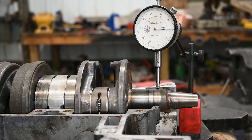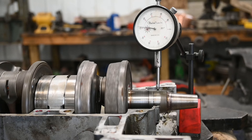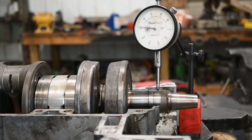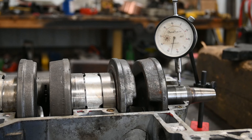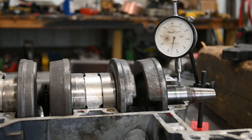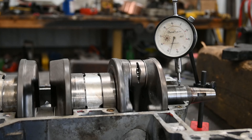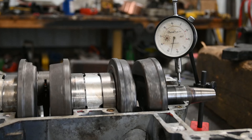I've got the crank over here in the top half of the case now. I'm going to check the runout on the mag shaft - it's pretty significant, there's a lot. I changed it up a bit - I had the crankcase sitting on some blocks and that wasn't really working, so I got the cylinder and hammered the piston out, which was rough, so I could set the crankcase on top of it and actually get a good swing without having to take it out. It's like a little over a thou, and we're going to call that good enough for who it's for.